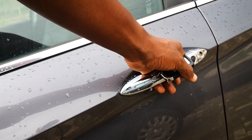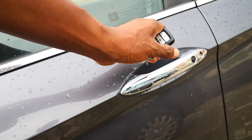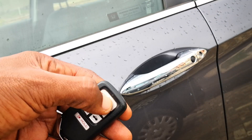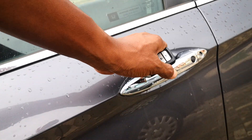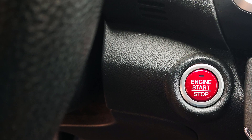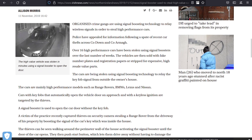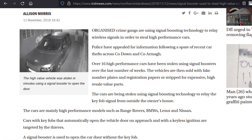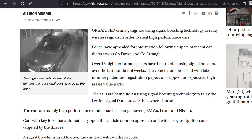When you hold the door handle of a car with keyless or smart entry, the anti-theft system via an assigned radio frequency will check whether the key or a programmed key signature is within a predefined proximity limit, usually about one meter, and if so, the car unlocks. This same technique is used to allow the car to start at the push of a button. However, using this same feature, thieves can acquire key signatures using a signal booster and relay the signal to the car, fooling the vehicle into thinking that the key is within proximity. Car door unlocks, engine starts, and the car is stolen.